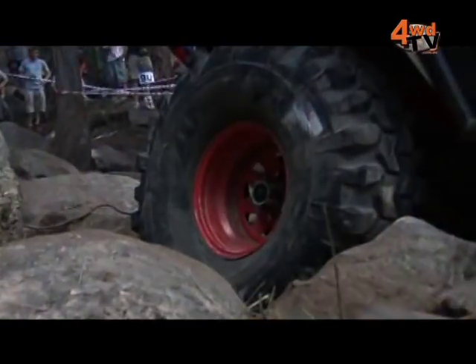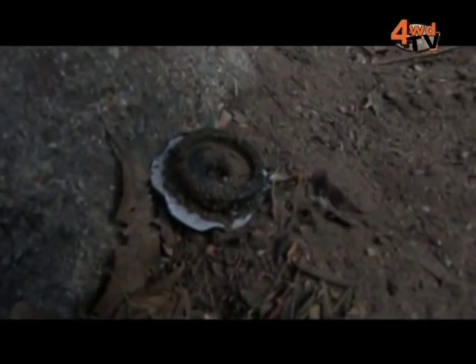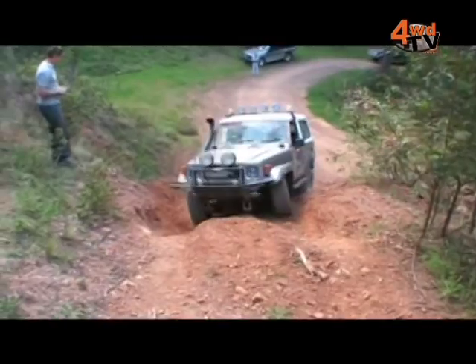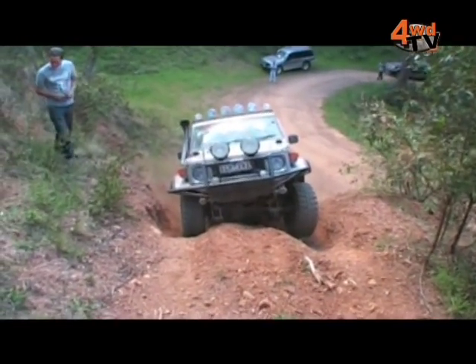And Phil, what are the main factors that cause hubs to break? It can be a couple of reasons. A complete hub fracture or a smashed hub can be caused by a vehicle that's lifted its front wheels off the ground under power and then slams back down, causing a shock load through the hub. That'll either destroy the hub or in some cases your CV joints.